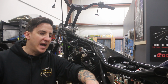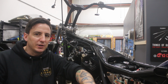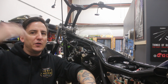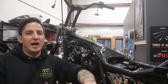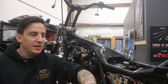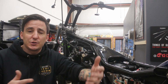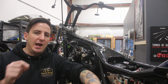There are going to be wires running in places that are not in the correct places based on the M-Unit, just in the way those circuits are laid out. One of the things about a Harley is those handlebar switches. All that stuff is 12-volt inputs and 12-volt outputs that are switched by the switches in the handlebars. This is the exact opposite of that. They have ground inputs, and then it transmits that ground signal back to the M-Unit. To be fair, just switch the 12-volt inputs for grounds and vice versa, and yeah, the switches will work either way. But you have to be cognizant of where the shared inputs and outputs are.